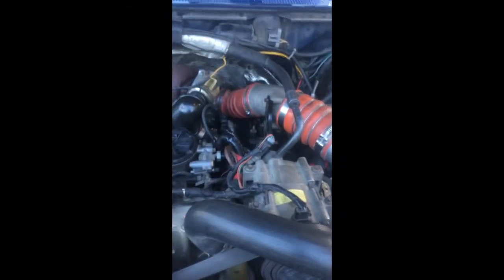That yellow wire coming into the valve connector did not match the yellow wire in the valve cover gasket - it was switching the cylinders around. We swapped the wires around, experimented, and found it. She runs like a champ now - running good. That's how you do it. It's Timmy coming to you from Alaska - tune in next time for something else.